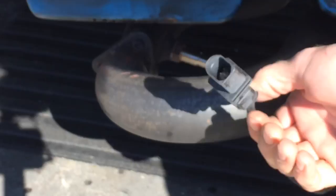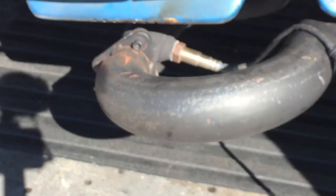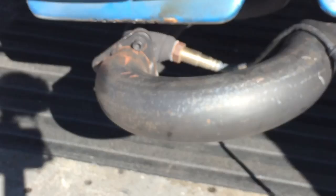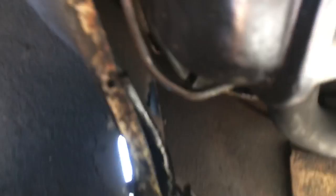Now we've got our plug sitting here, and we need to route this wire up and around. Let's get under the car and see what we have to work with. Here's what I did — it runs up right there and tucks in behind the apron. It tucks in between this double sandwich layer of metal right there, it comes over, my connector's right there, it's zip tied, and runs along the channel.